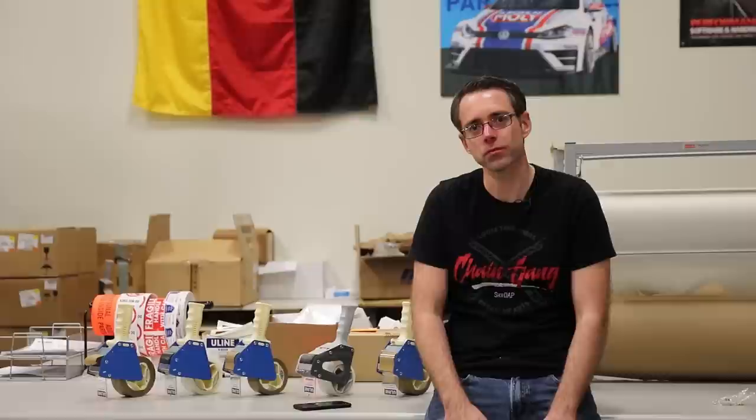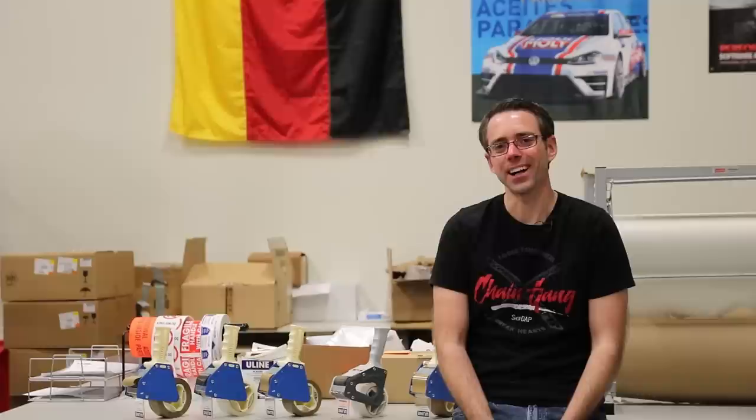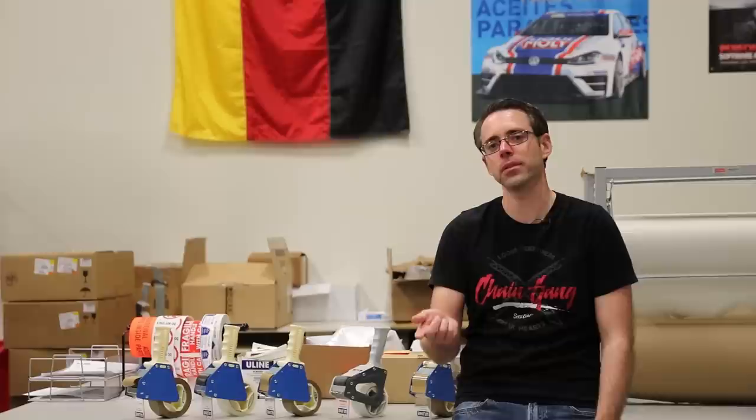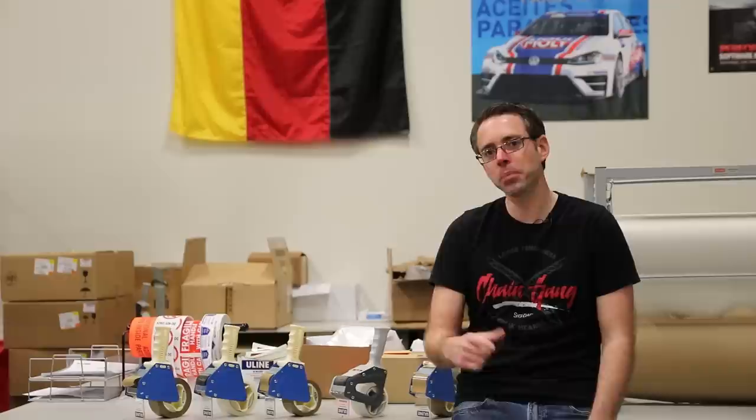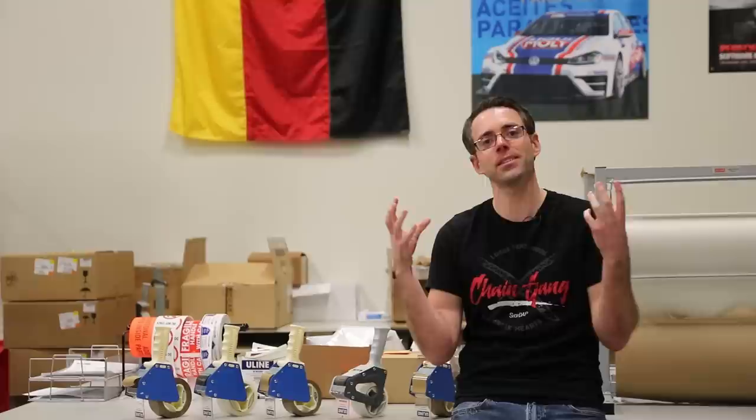Ben Svi via YouTube asked: with the first gen Audi TT front-wheel drive, is there a way to mechanically turn on all-wheel drive full time? Something like welding the diff? For anybody who's not familiar, older vehicles and off-road stuff — instead of putting a limited slip, which is very expensive, people will take a diff and weld together some of the components inside the differential to basically lock the two wheels together. This is generally a terrible idea.